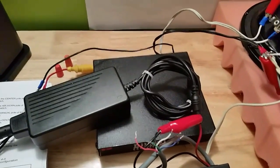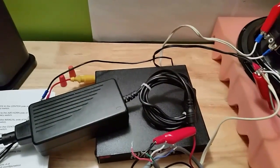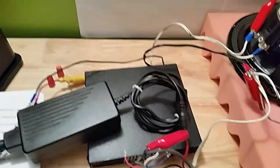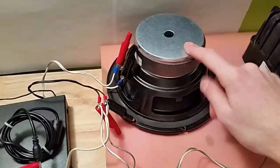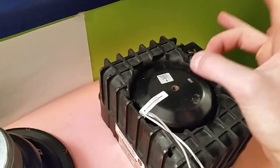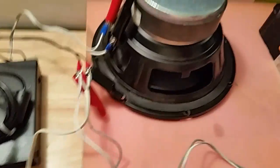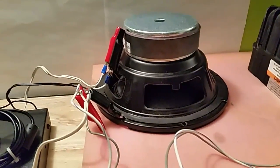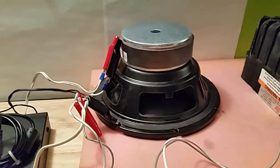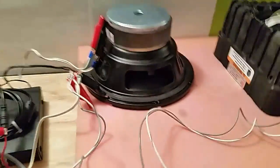The Rumbler amplifier is effectively just an inline low-frequency amplifier — it doesn't generate anything, it just amplifies whatever you put into it and puts it back out at a very low frequency. For that you need some kind of bass driver. This here is like a PA speaker with a cone, diaphragm, and magnet. This is just a traditional subwoofer bass speaker out of a home theater setup. The Rumbler speaker you'd buy from Federal Signal is effectively just that in a small round housing.